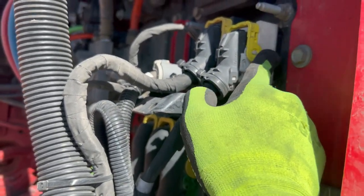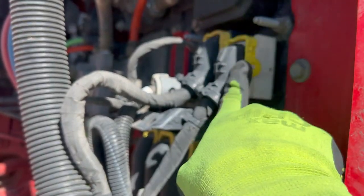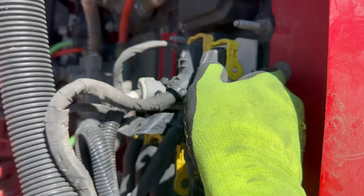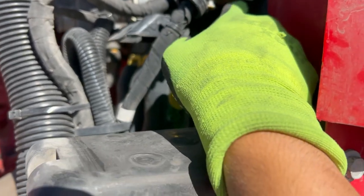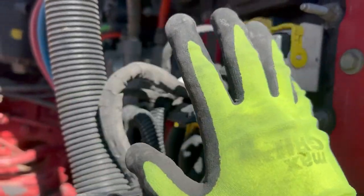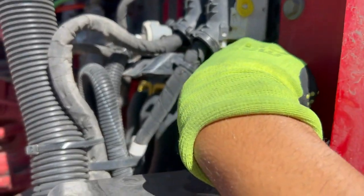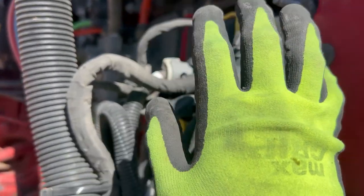He said it was this fuse right here. The problem was that the handle was broken off of this fuse, which was causing it to be really loose and come off, triggering the code. He also said he thinks that someone was probably a little too rough with this fuse at some point and broke the whole thing, including loosening the port in the back on the actual box itself.